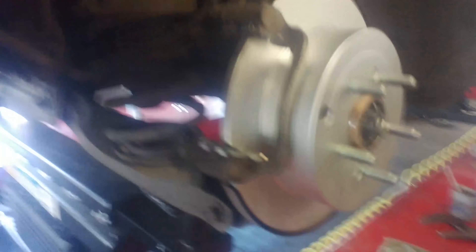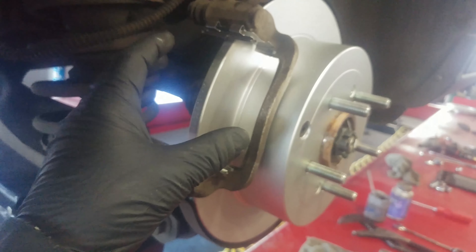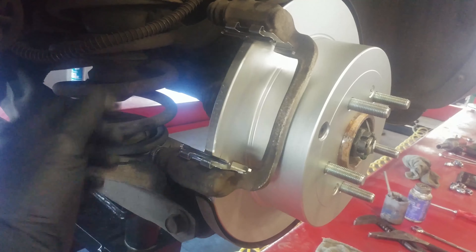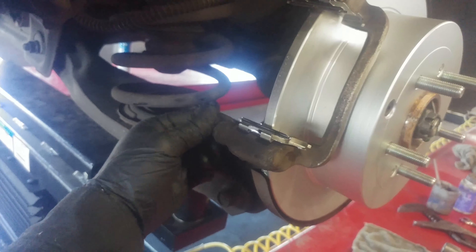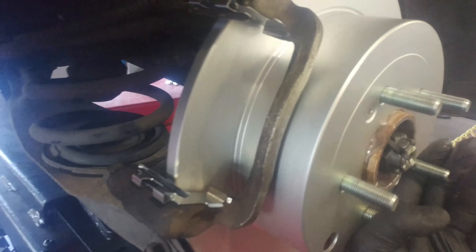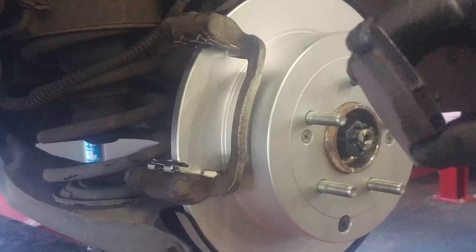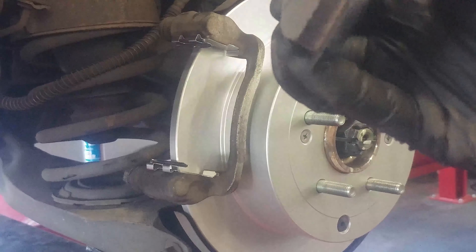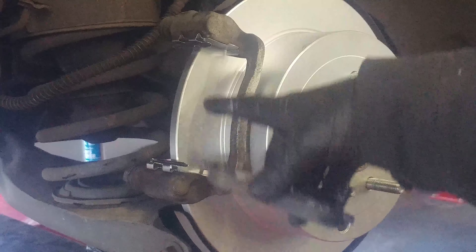When you're getting ready to do your brakes, you do want to collapse the caliper. You also want to make sure the slides move — if they don't, you'll want to consider getting new calipers. You can see that slide is pretty nice. We'll slide our brake pads in. You can put a little lubricant on the edges of the brake pads — just on the little edges where it sits, not on the surface of the pad.